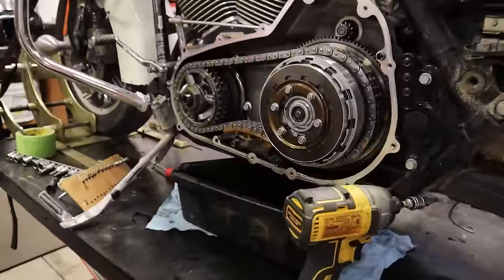So what blew the first gasket — the nitrous? Yeah, it was rider error, kind of. When you're blowing nitrous it's generally at high RPM, full throttle — you just want that extra shot at the top. When we were playing around, Sean was doing roll-ons with the nitrous, just blowing nitrous. This is like the biggest shot of nitrous you could possibly throw at this thing, and he was doing roll-ons just building up until it finally let loose — pretty big explosions going on inside that cylinder.